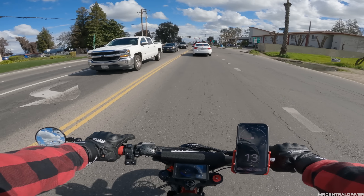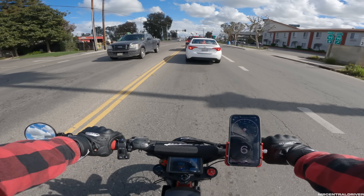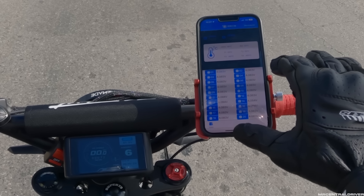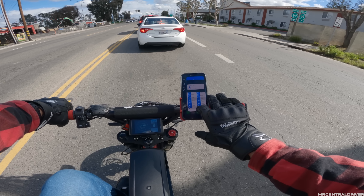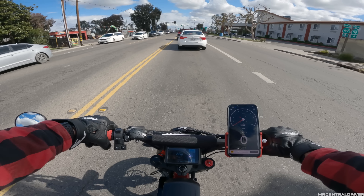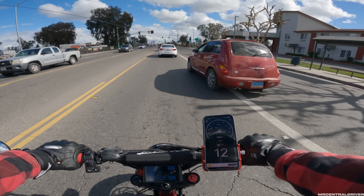I was able to check the ANT BMS and we're already down to 4.083 volts per cell, and they're all pretty much even — only 0.002 volts off, which is pretty good. But this isn't a huge battery — 13 amp hours is decent, it'll give an extra punch, but it's the kind of battery size you'd normally use on a 350 or 500-watt motor.